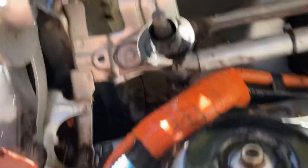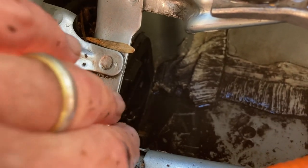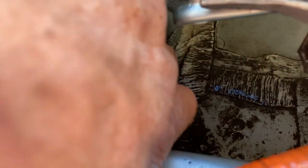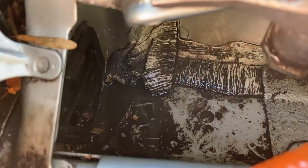Before taking that last piece off, I noticed the passenger footwell was getting all wet on this side. On the fender there's a little valve, and that was clear and free. There's a little bit of dust and debris here but not much.